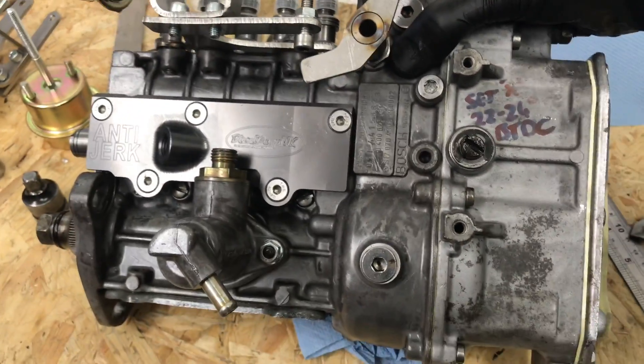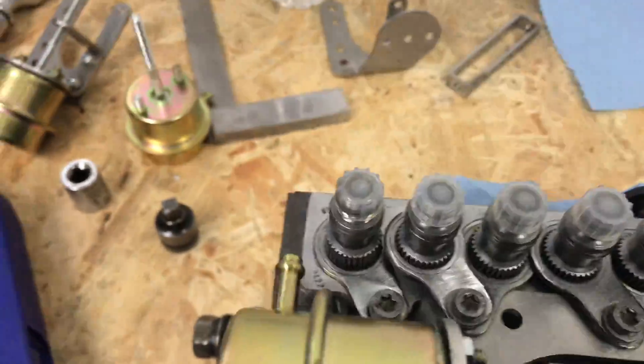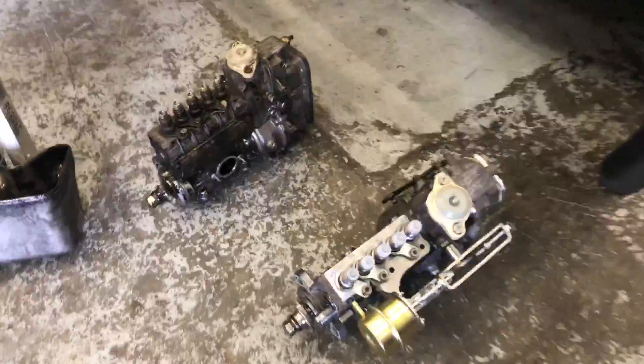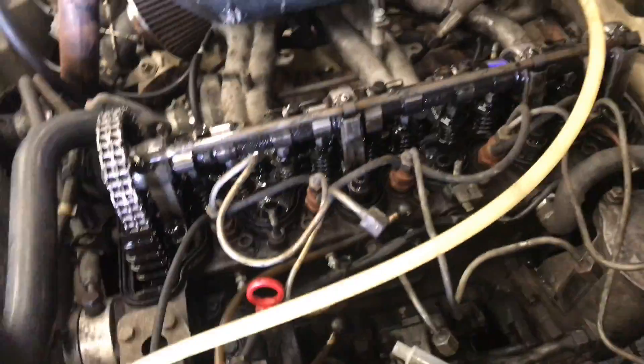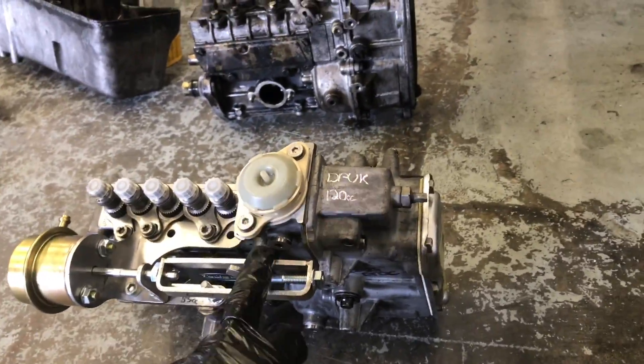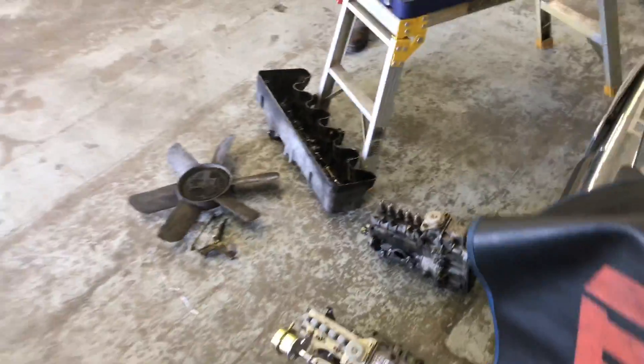The aluminium is a little bit tarnished but overall it's beautiful — look at that anti-jerk plate on the side. We don't actually utilize the anti-jerk system on these; it's more for a better seal and a better side plate. This is the pump that's going on. Old pump versus new pump — the rocker cover is off because it helps us find the correct orientation of the engine, and it needs a valve adjustment anyway. You can see that's where the pump gets pulled off — three bolts. This is an M pump, the European style, different to the turbo 617 pump.